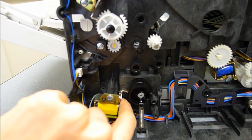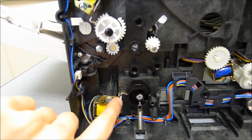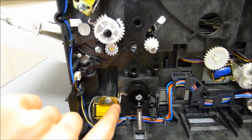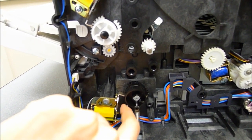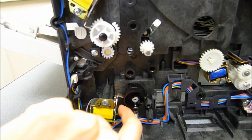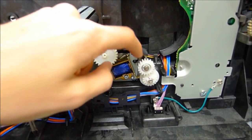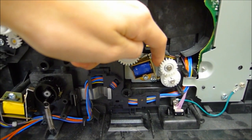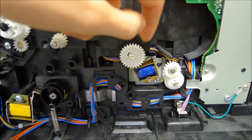These gears get held back and forth by these solenoids, which are little magnets down here. Originally when HP sells these, there's a little tiny bumper that basically prevents noise. But over the years, that bumper gets worn down, and then all that's left stuck on the metal is just the adhesive that originally held the bumper in place. You can already probably tell where I'm going with this — the adhesive causes this little metal armature to stick in place.